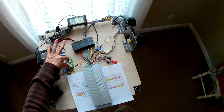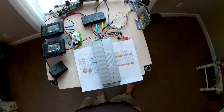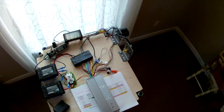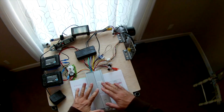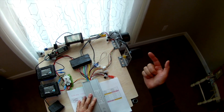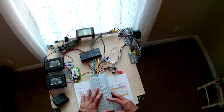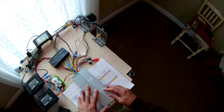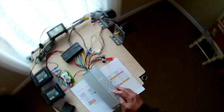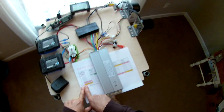We've got the meters set up — just the phases connected, no hall sensors yet. Main power on. We're going to leave it like this for about 30 seconds. The controller is learning how the motor is set up with the phases. That takes about 30 to 40 seconds or so. As you can see, it's running forward — which in this position is supposed to be reverse — but I think it was already running forward.